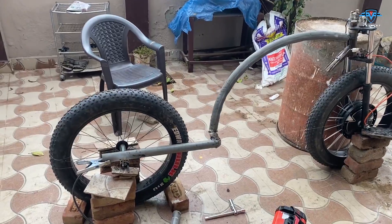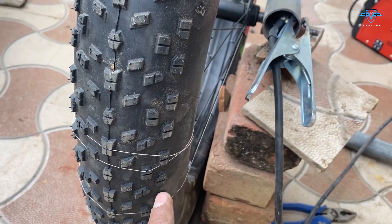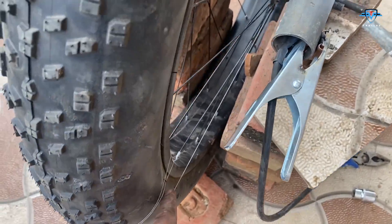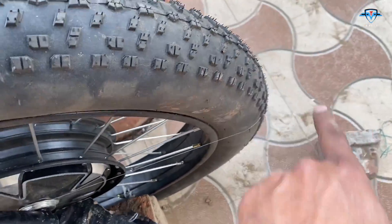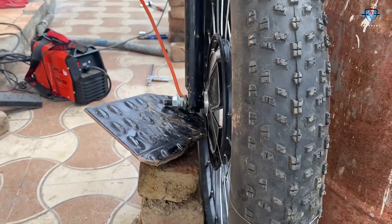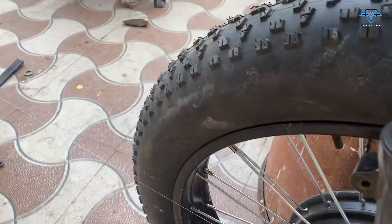The structure is ready. Let me show you one technique. This thread right here is what I used for the alignment. So it goes here, then here, then here, and at the end here — so it's tied there. The concept is that this thread will be straight and it should just barely touch the side of the tire.